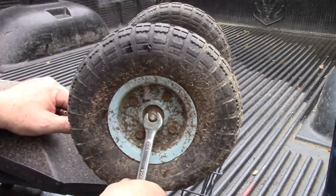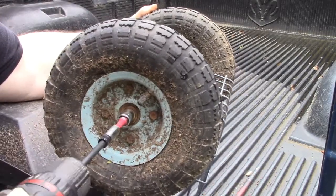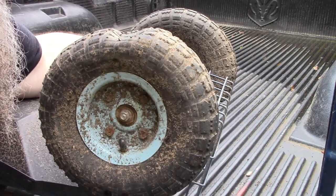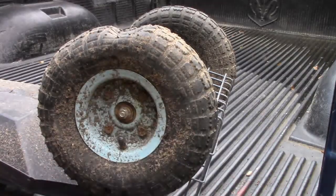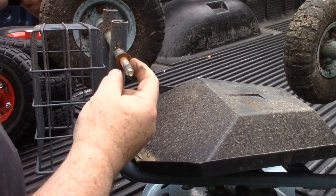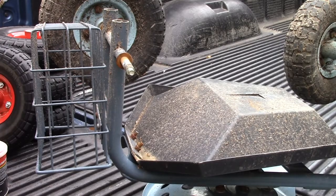So I need a way to hold that. Before I go too far, I'm going to use my half-inch wrench on the other side and my socket on this side and see if I can get this broke loose. And there we go. So actually what happened was the nut on the other side came off. You can see I got the washers for that. But now that I got this off, I'll grab this with some vice grips and be able to take this other end off. And then when I put them on and tighten them, they'll be just fine.